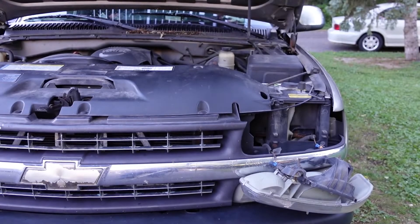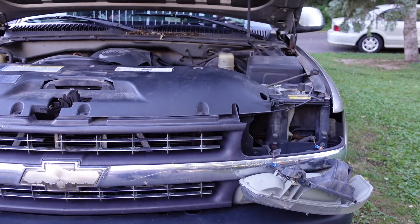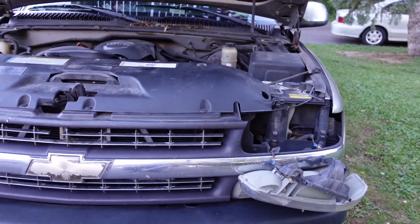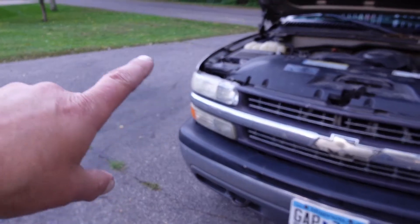Welcome back to Do-It-Myself Garage. As you can see, I've got the headlight out. I was looking at the running light to see what kind of bulb it was. You can find online which one it is, but I wanted to make sure it was actually burnt out and not just a bad connection. As I got in there, it was burnt out. I also found out the headlight on this side is out. I always buy my headlights in pairs, so we're going to replace the one on this side also, and I'll show you how I got the bezel out and how to put the whole thing back.